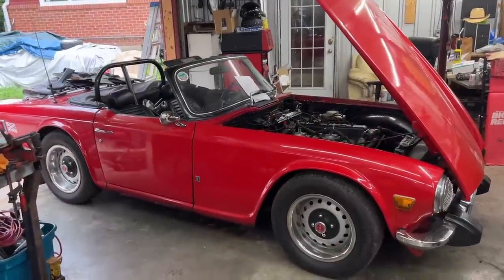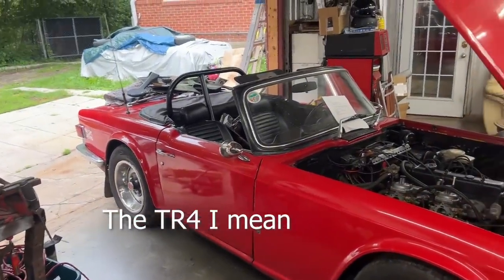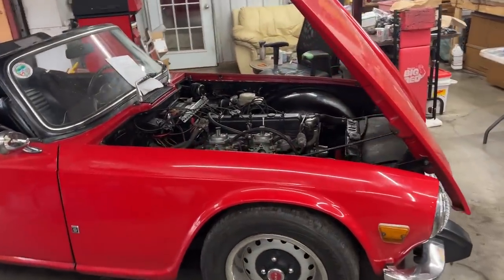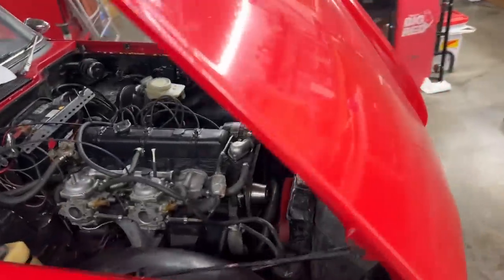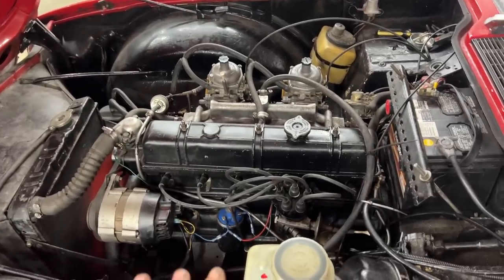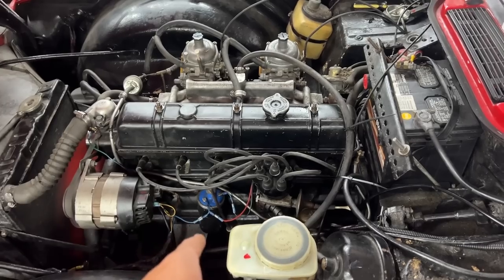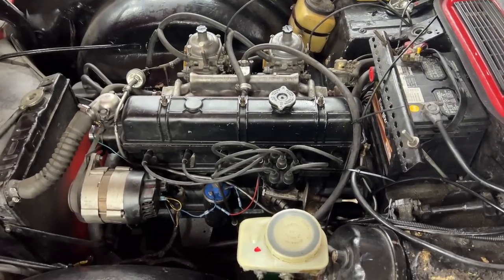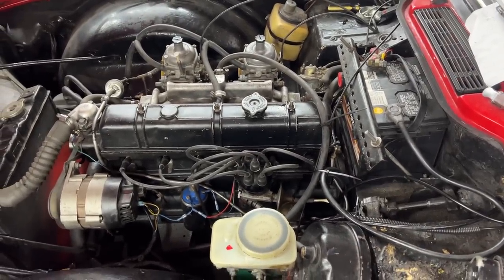It's actually the next day and we took out the Spitfire, so now it's gonna be easier for me to tune up the engine a little bit. And as you can see, she's running pretty rough still. So what we're gonna start with is the ignition system, and we're gonna change some of the components already because the owner brought new spark plugs and a new coil. So I don't know if these are bad or not, but why not start with new ones fresh. And I think also the distributor cap needs to be changed. I have ordered a new one. I will show you now.